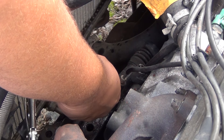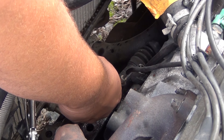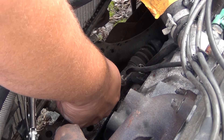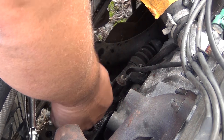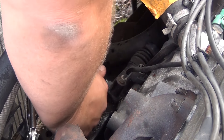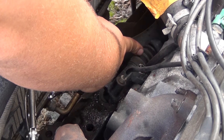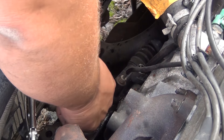The more you do this, the more the pressure in the pedal is gonna build up. Open it, let the air out, pump it again — and you can see it's starting to come out more now.